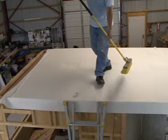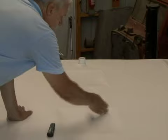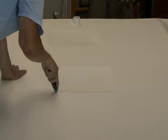That looks pretty good, so what I want to do is carefully back off of here and take one last look. We're going to go ahead and cut our vents out now. That way we can push any air bubbles out that might be around the vent opening. Basically all we're going to do is make two diagonal cuts and let our flaps drop down inside — just go from corner to corner.